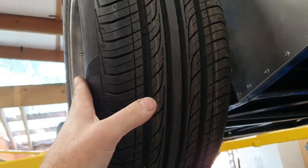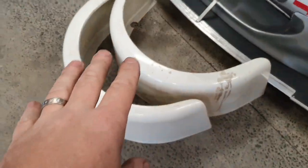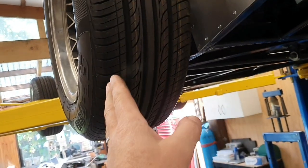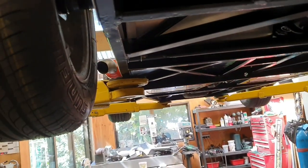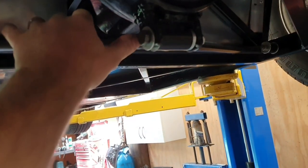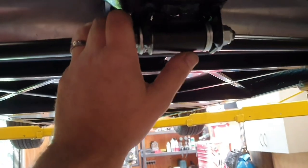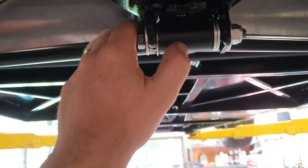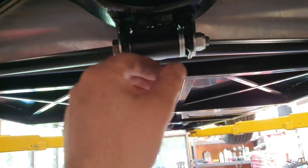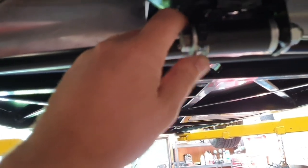Before doing that, there are other things to consider — the width of the tire from the body, how wide the guards are. I put one wheel on one side and checked the other side, and the axle is not sitting in the middle of the car left to right. Things have moved — that's what tends to happen when stuff gets powder coated and you don't have adjustments built into your suspension arms. So I've cut this bush and chopped some off one side so the whole diff can be pushed the other way, which is the direction it needed to go to get into the correct position.